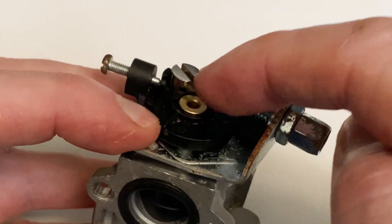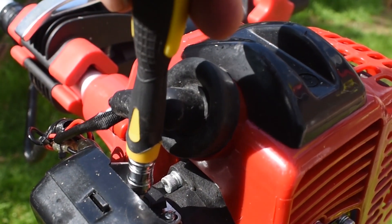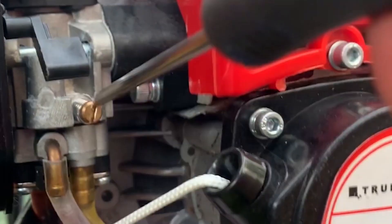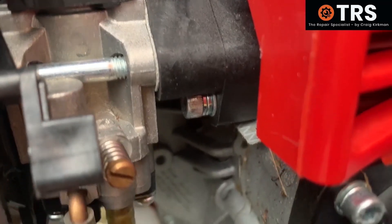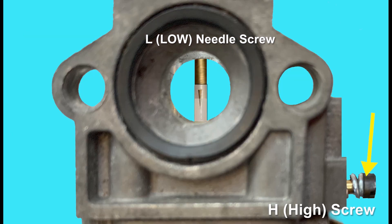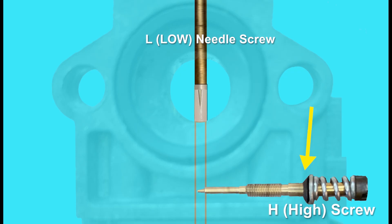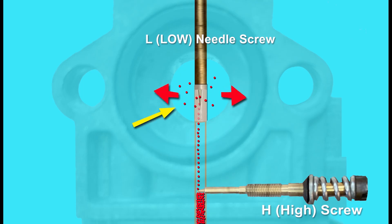So that's the hidden L screw explained and the low RPM adjusted. Now we've adjusted the low screw, we'll go ahead and adjust the single adjuster screw for the high RPM. The H screw doesn't protrude into the main jet from the top like the L screw does. It's set lower down deep inside the carburetor, and the tip of the H screw protrudes into a fuel hole within the carburetor where the fuel passes on its way out of the main jet into the induction tube before reaching the engine.